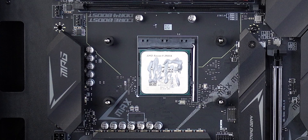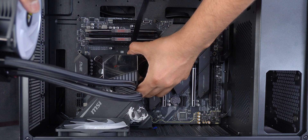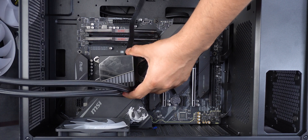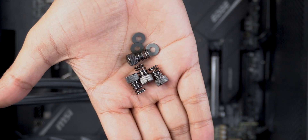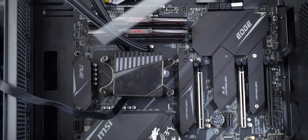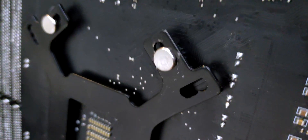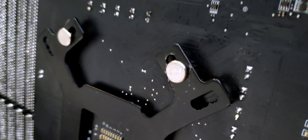I applied the thermal paste in the weirdest manner possible. Installing the pump will be a nightmare if you are trying to shoot and install at the same time, but it will definitely be easier with a couple more hands — meaning a separate human. The backplate needs serious pressure as you put the pump on and screw its screws alternately. Even after the pump gets installed and fits perfectly, the screws will keep rotating endlessly. This happened with both AIOs because the free play carries to the screws on the back — the locks on the backplate don't really keep them locked.